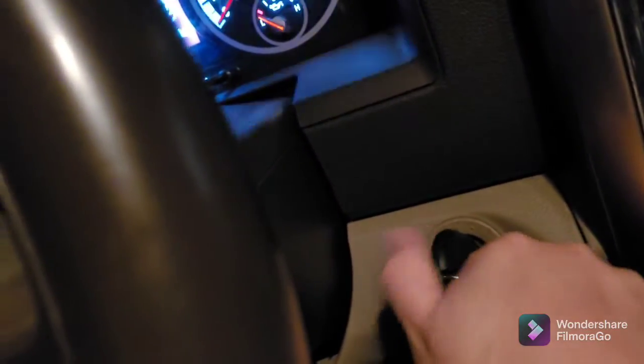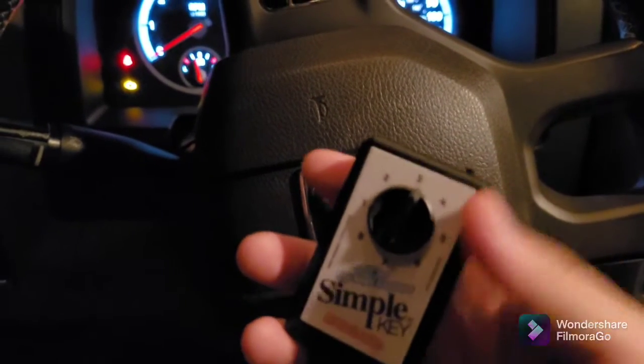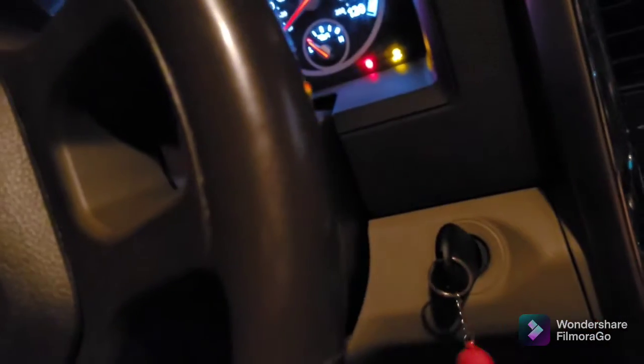There are the three beeps. Now we're going to turn it off and put the new key in. We're going to set it to run — the on position — and this is dialed to three. Press the button — beep beep — press it again, three beeps. Now remove the key fob. Remove the OBD2. Now we test the key — and boom, there you go.